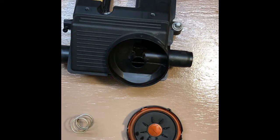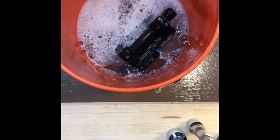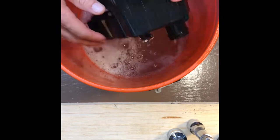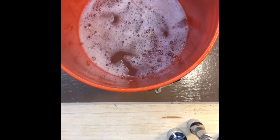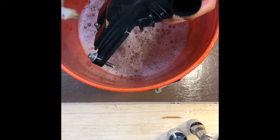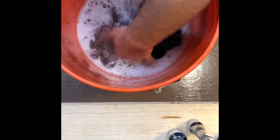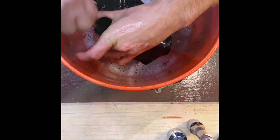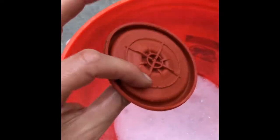For this purpose I'm gonna try to use that degreaser. Honestly this part is not expensive, but I decided to clean it with water — there are no electric sensors, nothing complicated. I used a toothbrush and went all the way, submerged this piece of plastic and cleaned it really good. You can remove that without any problems, use some soapy water, be gentle with it, and just wash the old oil out. Once it dries out we're good.